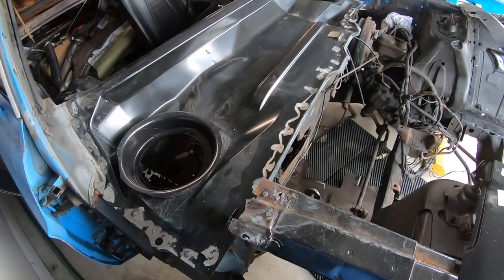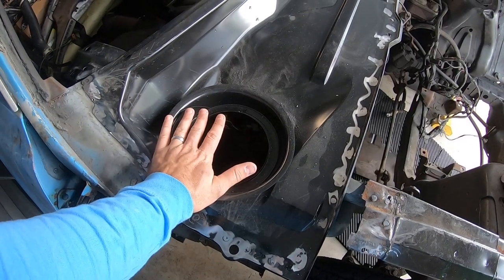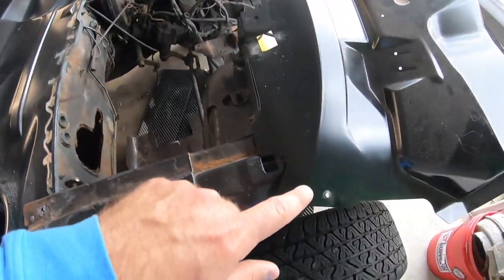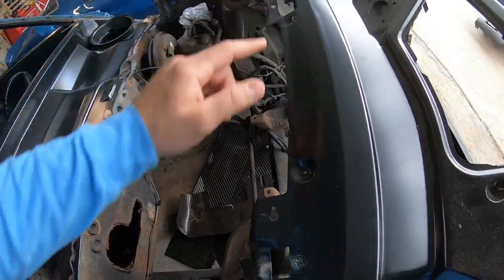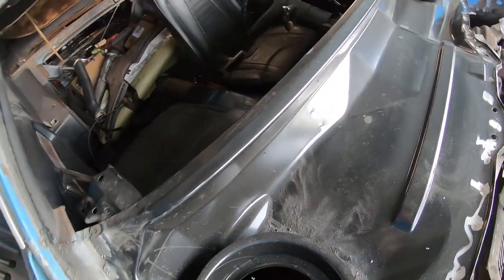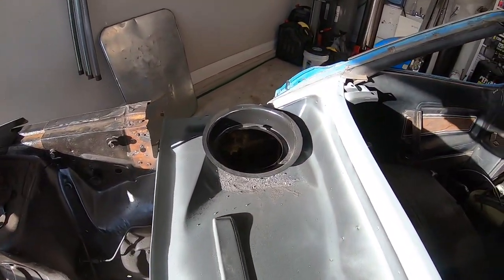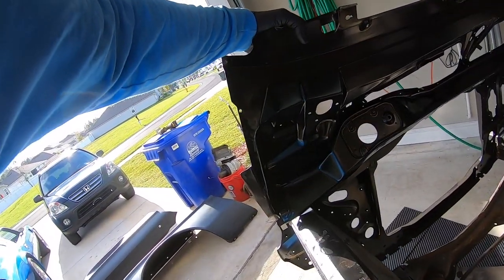Okay, moving forward, putting the upper cowl onto the lower cowl, what we're going to do is weld through primer the edge, okay? All right, and this beam, this section here gets welded to this, all right? So we're going to buzz that down and weld through primer that. All right, so here's the weld through primer. See, it's gray. Got it. All those areas. And we'll hit the back side of this.